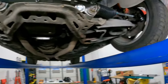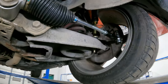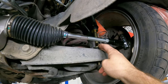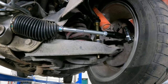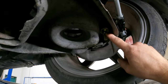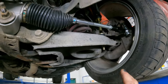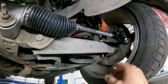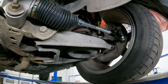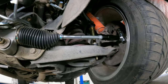The other thing is when you're tightening these down, you do not need to squash these polyurethane bushings out. If you're using OEM rubber replacements, you don't need to pancake these either. I see it all the time — people just wail away on the nut on the bottom here, and it is a lock nut. The whole theory behind a lock nut is it locks itself in place, so don't go crazy. You'll hear these things start to squeak and get tight — just stop there. Don't under-tighten them, but by all means do not over-tighten. You're defeating the purpose of those bushings if you do.